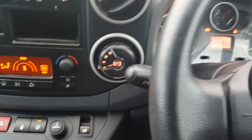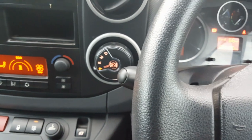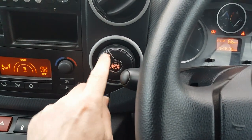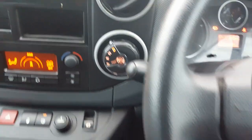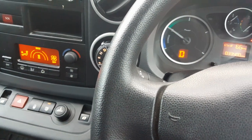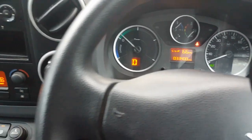To put it into gear, you've got to keep your foot on the foot brake. This is your gear selector: reverse, neutral, drive. Select drive, take the handbrake off, then release the foot brake — and you do get a bit of creep, as you can see the vehicle moving forward.